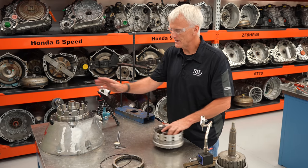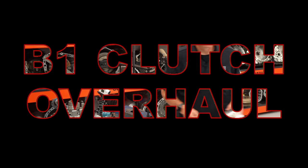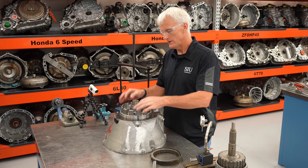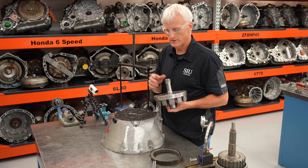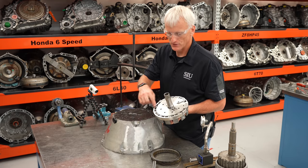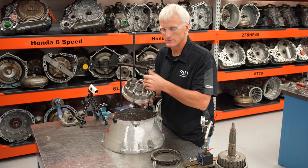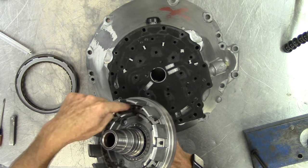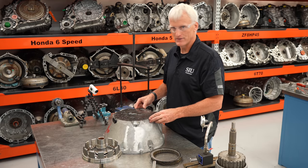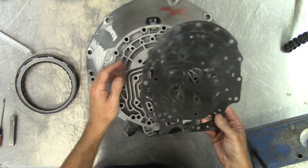The K1 clutch is done. Moving over to the B1 clutch — we're almost done with all the clutches. I already got a head start on this since I took the B1 clutch out to show it's essentially the same as the K1. I need to take these T45 bolts out. The T27 bolts I took earlier from the bell housing side were going into this B1 clutch housing. With the T45s out, here it is in my hand. There's a kind of a rubber-bonded gasket separating the B1 clutch housing from the bell housing, and also the oil pump. Those T45 bolts in the middle hold the oil pump housing, which is on the bell housing side — it's held in by an O-ring, so I'll give it a couple little taps.